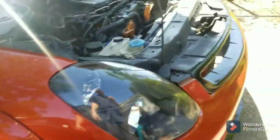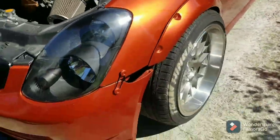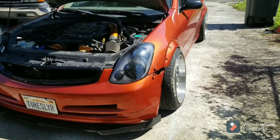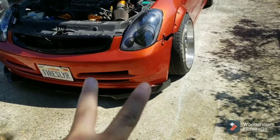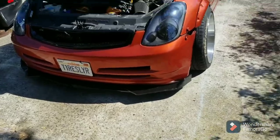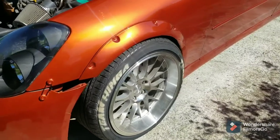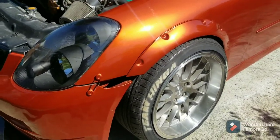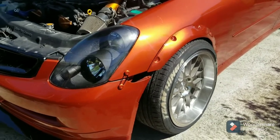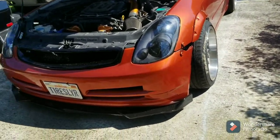I've made a video about my angle kit, so go on my channel, go through my videos, you can find the angle kit information. I use the FDF Fab Mantis kit. They have 2 kits. The big one's called the Mega Mantis, and the other one's called the Mantis. I call it a mini Mantis, but it's just called the Mantis kit. This is the smaller kit. So it's just the basics to get you big angle: lower control arms, compression rods, inner outer tie rods, offset tie rod spacer, and the mount for the angle.